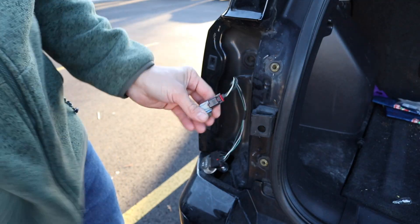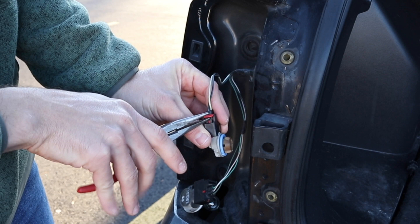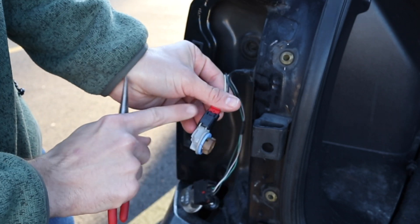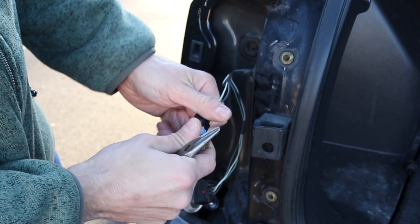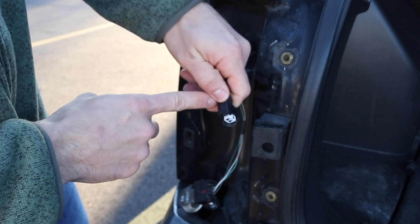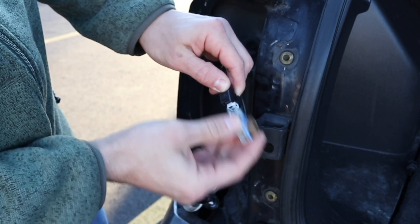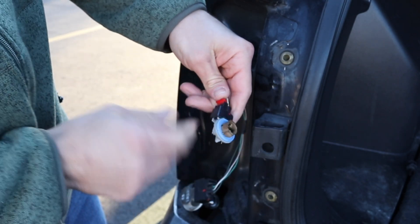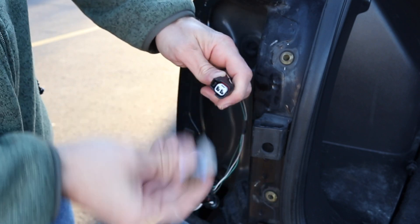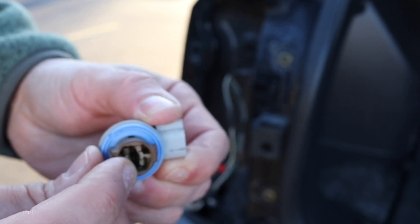So what you'll do here is there's going to be this red piece here that connects with the black. What you can do is with the needle nose pliers, elevate this red piece very carefully — or you don't even need needle nose pliers — but you basically elevate the red piece here so that it's not sticking all the way down. Then you're going to squeeze on the black part and very carefully pull this out. When I first did this, it was a little bit difficult to pull out where I had to press a little bit harder. But what you'll notice is if you press the black piece, it elevates so that you can actually pull out the socket. If you look up close, the contact on the top is still in place but on the bottom it basically broke, so that's why it's broken.